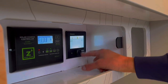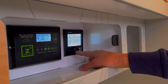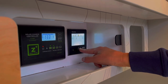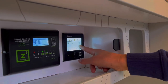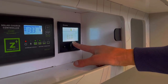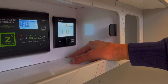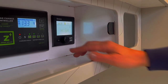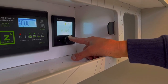Best practice when you get to camp, if you want to make sure you have hot water ready to go at any point, is to immediately set it to Boost to get things up to temperature, and then go back and set it to one of the lower settings for regular use. There's also a fan icon you can select. When the heat is set, you'll have either Eco mode or High mode — this is just fan speed. If you're not running the heat, you can still use the Truma as a fan to circulate air throughout the cabin, and at that point you'll have about 10 different fan speed settings to cycle through.